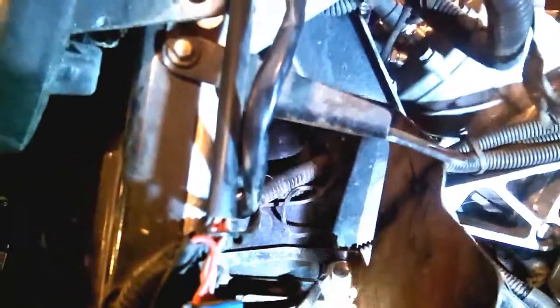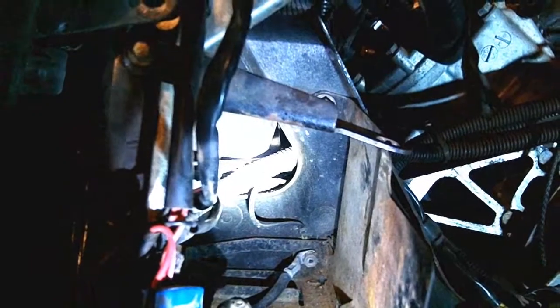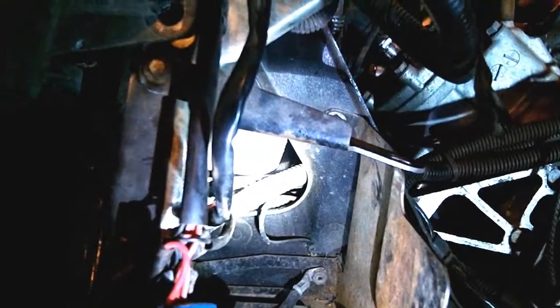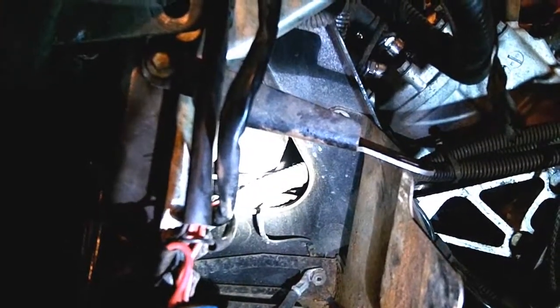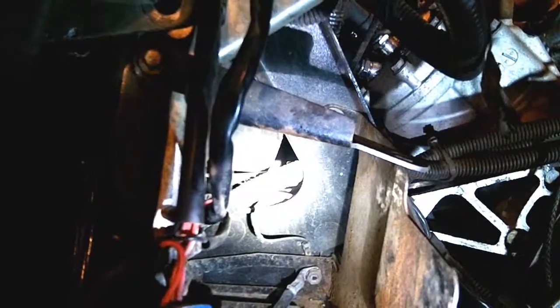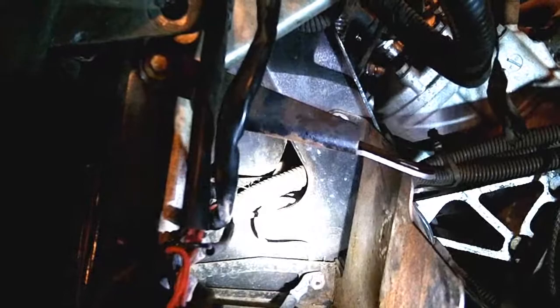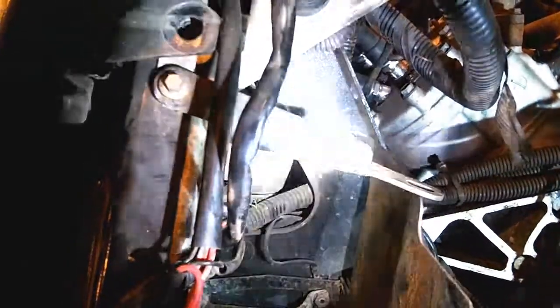You can see — let me grab the light — we're squeezing between the frame and gas tank there, and that's the trouble part. The quick method would be to cut the end of the wiring harness; you will get it through there. If you know for sure your CCU is bad you can do that, but if you're not sure I wouldn't do it.